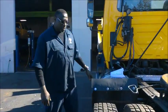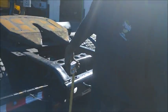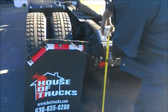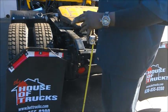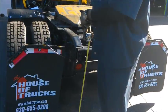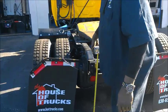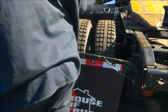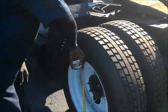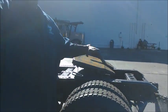The last thing you're going to do is check your ride height. When you do that, you measure it from here to here — you get this number. Check your manual for whatever vehicle you're working on to get the proper specs. You measure from here to the center of the tire. You track those numbers and it'll come up with your ride height.